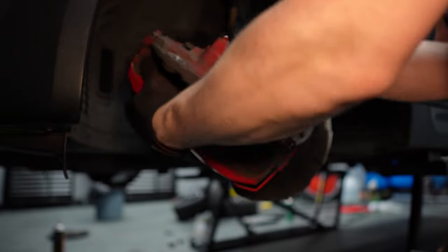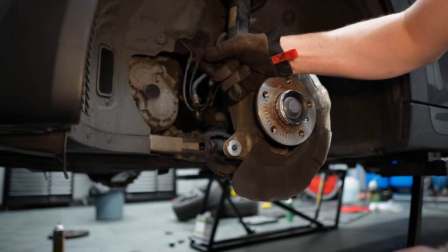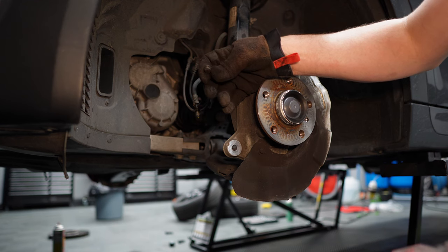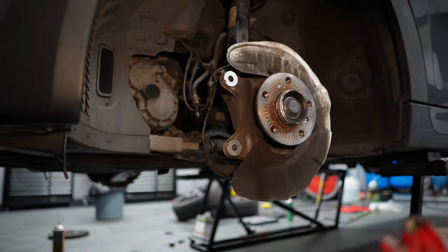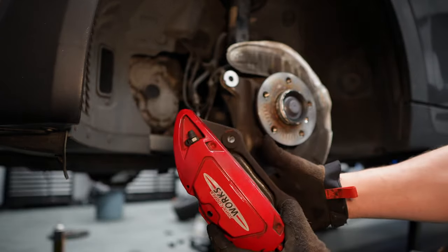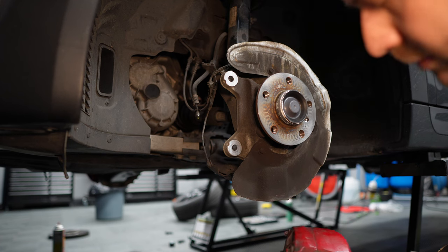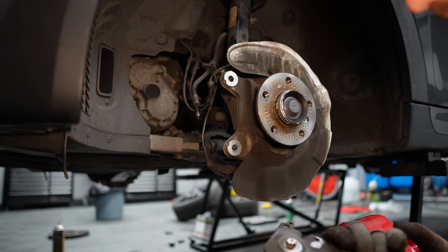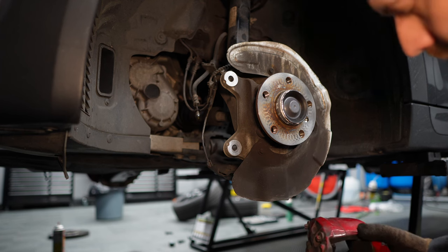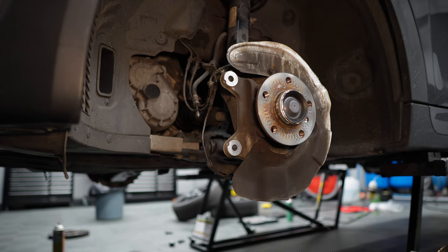The last thing holding this in is the wear sensor, which can lift out. If yours hasn't been worn down yet and you don't have a brake warning light on, you can reuse it — I bought new ones but I'm going to reuse them. Here's your caliper — that's what it looks like off. You can see the pads are in there. The pads actually load from the top, so you pull the pads out and up because they have centering clips on the back. Next, clean your caliper with some brake parts cleaner.